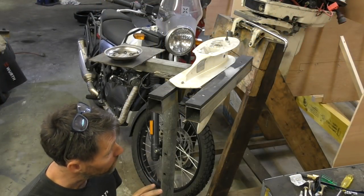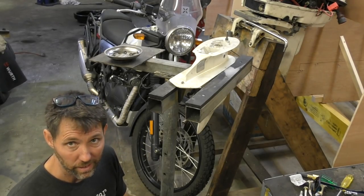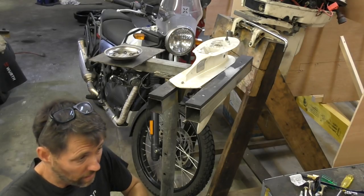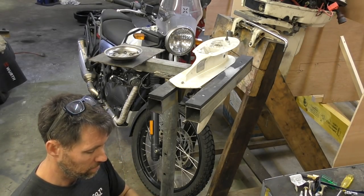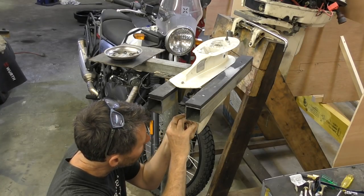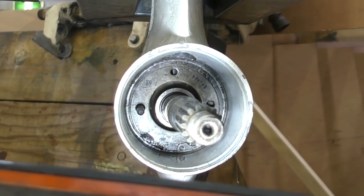Although I think it'll go in pretty easily, I actually can't quite reach in with my fingers, so I'm going to use a socket with a bit of Blu-Tack in it. Blu-Tack's great for situations like this — times when you need to stick a screw on the end of a screwdriver if you can't hold it, all that kind of stuff. So I'll just stick a bit down the socket, put our rod in, then wind it in. There you can see on the left hand side we've got our new little homemade guide pin wound into the plate.